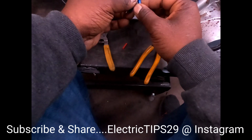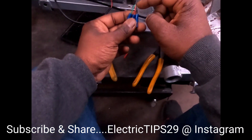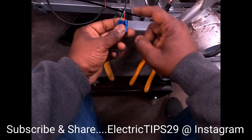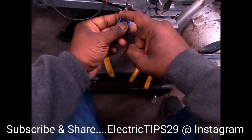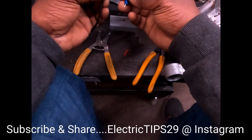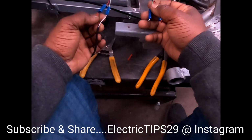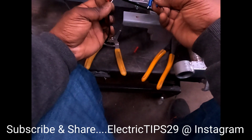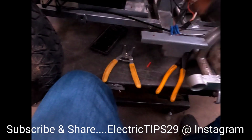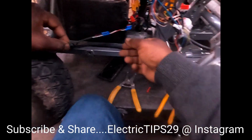Find the actual throttle wire, which is normally a positive, a negative, and a neutral wire. That neutral wire is sometimes white or green in most applications. So for example, here it is on the other one, which is white. You've got a positive, a negative, and a neutral wire. This is the throttle already hooked up to this controller. This throttle right here has been cut off.